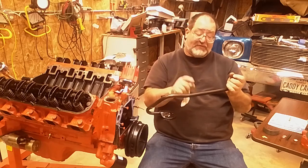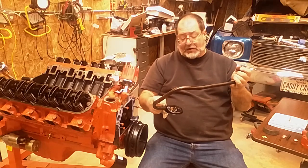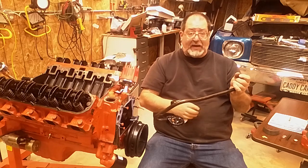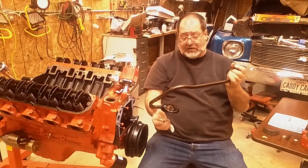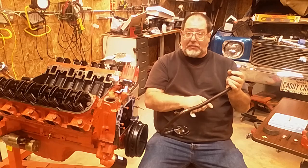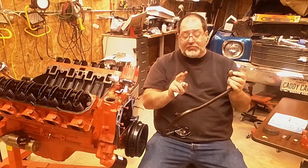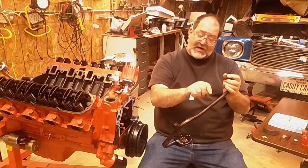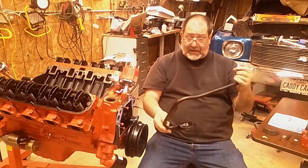If you make your own pickup tube and splice it together, you need to make sure that any section above the oil line is leak-free. You can pressure test it - put air in one end, try to hold a plastic bag at the other end, spray some Windex on it, and look for bubbles. Make sure there are no pinholes in the pickup tube. I have lost two motors to a pickup that looked perfectly fine but had just a pinhole leak that was aerating the oil.